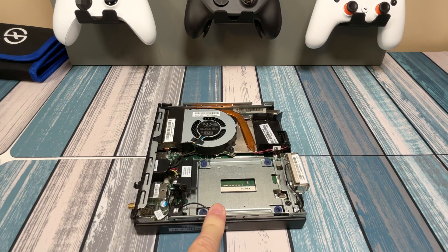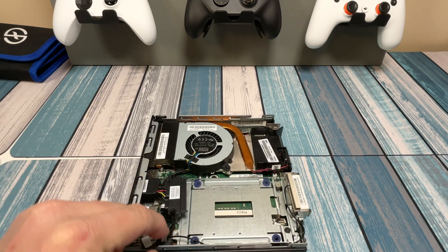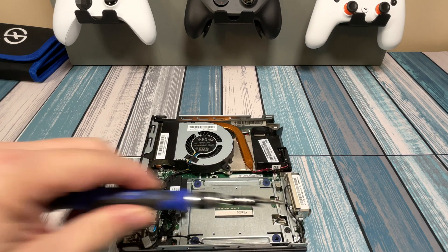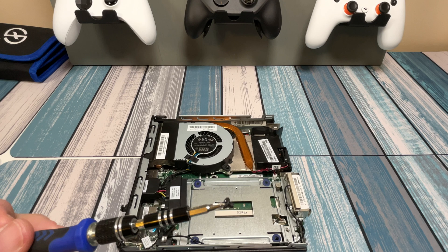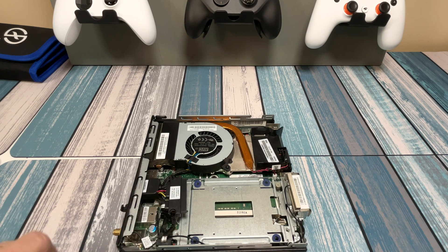The first thing I'm going to do is max out the RAM. Once we take this drive tray out we'll see where the RAM slots are and what it comes with. Buy the absolute minimum RAM configuration you can find — if it's a four gig version don't pay extra for the RAM, because it's probably more expensive than just buying it yourself. I'll have links in the description for compatible RAM on Amazon. We're going to be using a 16 gig kit, which was pretty cheap. The drive tray has two screws but most of the ones I've bought only had one in it.